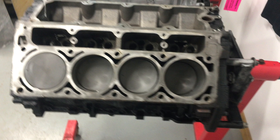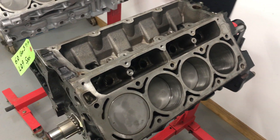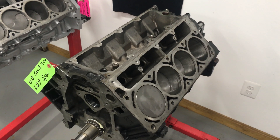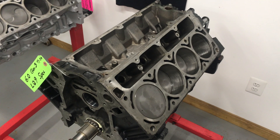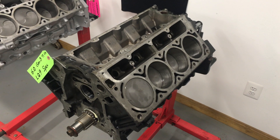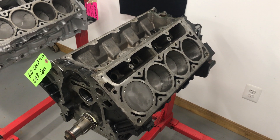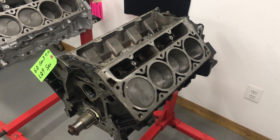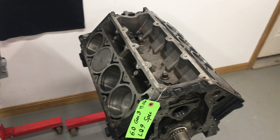So if you're looking for a great start to your project, we've done all the heavy lifting here. This puppy's ready to go. How much horsepower will it make? I don't know — we've gone to about 600 horse with these units with different cams and different heads. This is a 4-inch bore, so you can use just about any head you want, except obviously the LS7 head, which is totally different.